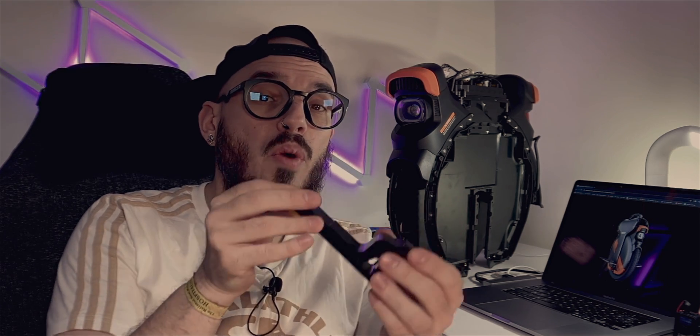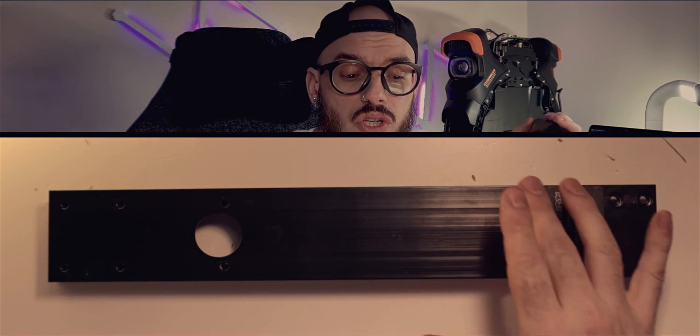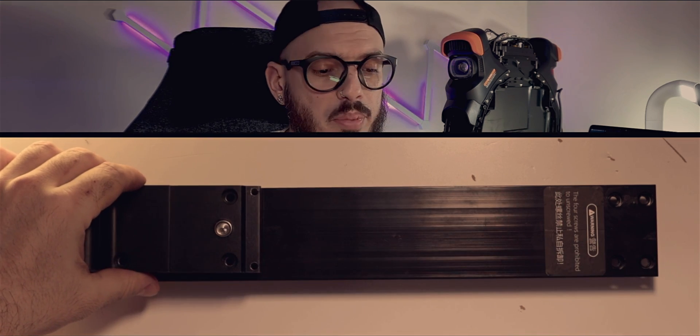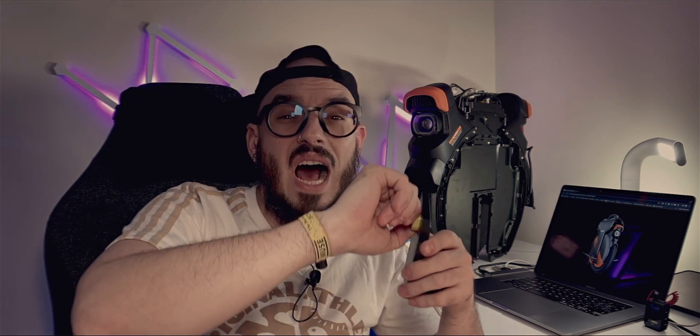Another difference I noticed is in this rubber on the other side, which is really important for maintaining the position of the pedal hanger. Looking at the structure on the table — the part you attach your pedal to that moves up and down with the suspension — on the previous version this rubber was slightly softer, so this part had a tendency to go a little out of shape, creating more movement in your pedal hanger. That's another improvement I found on the V11Y.